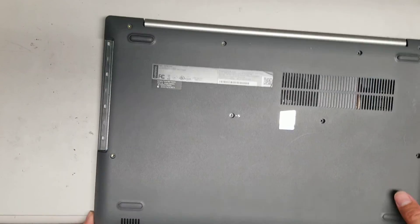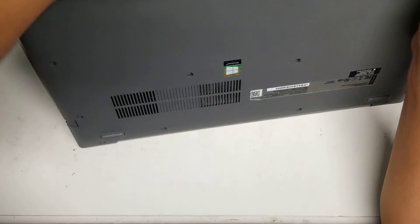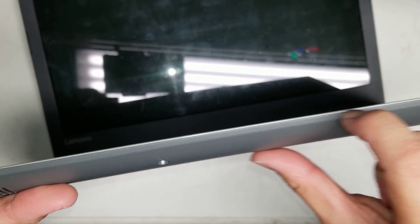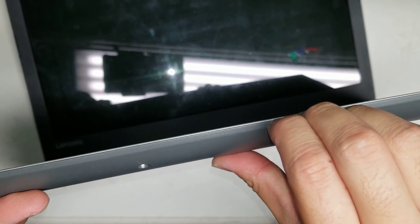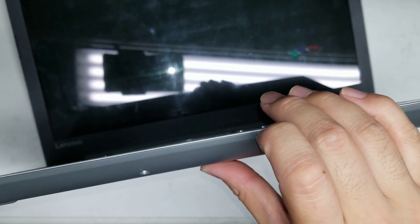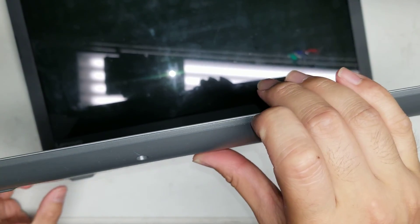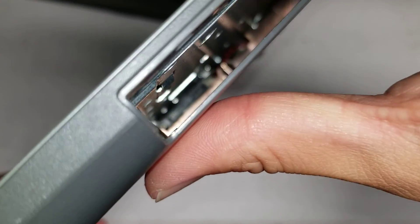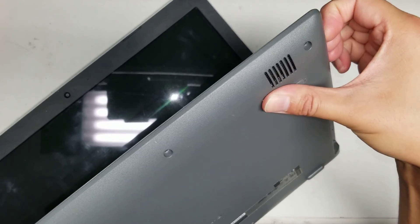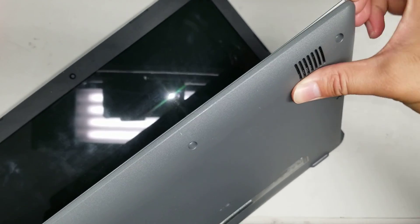Once you do that, we have to pop it open. To do that, you'll want to get between this dark gray layer and the silver layer. The gap between here is very thin, so it might be difficult. If you can't, you'll have to use either a very thin pry tool or find another way. You can kind of start from the CD drive slot area — it's a little bit easier because the plastic is in there. Then you can slide your fingernails or pry tool around and get over to the front.